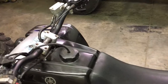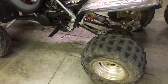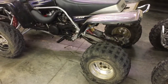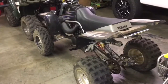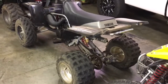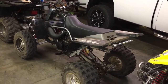We replaced some bent handlebars - every Banshee you see has them missing or bent. It's got new silicone radiator hoses and it's bored 30 over - it was stock bore when we got it. The previous owner had been letting it sit outside for about a year with the air box off. Water got through to the cylinders and the bike was locked up, but we got it unstuck at his house and picked it up dirt cheap.